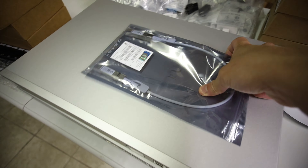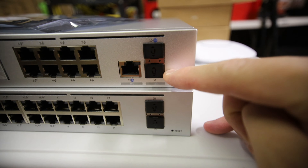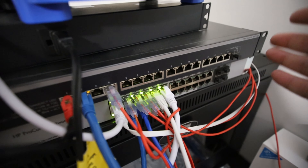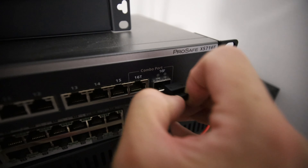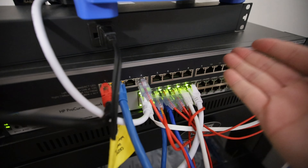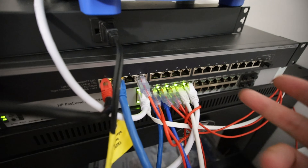I also got a DAC cable — a 10-gigabit direct attach cable — which will go from my 10-gig LAN port into my Netgear 10-gigabit switch. I'm not really using it currently and don't have any 10-gig servers at this location. This is a Netgear XS716E 16-port 10-gigabit switch. I'm hoping the Ubiquiti DAC cable will work in the SFP port so I can aggregate for 10 gigabit. I'll be doing VLANing, with my main editing and gaming PC, a couple of servers, and a file server for video content. My whole house is wired for Cat 6A.